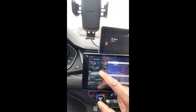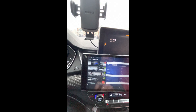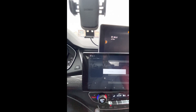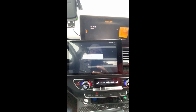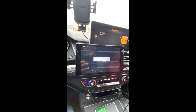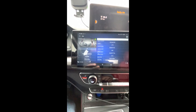Since we are looking for the air-out option, we want to go to Level Control — Chassis Control within OBD11. Click on Chassis Control and wait for that to load. A lot of people have been asking me about this, so hopefully all questions are answered. It does get a little slow sometimes. Now we are in the Chassis Control, which is how we will access the modules that control the air suspension.